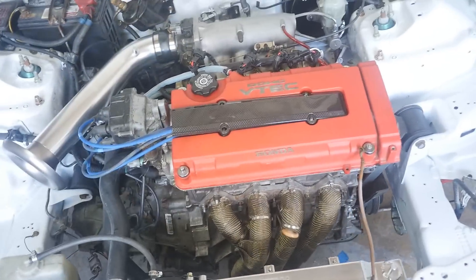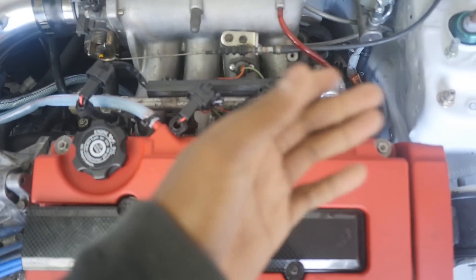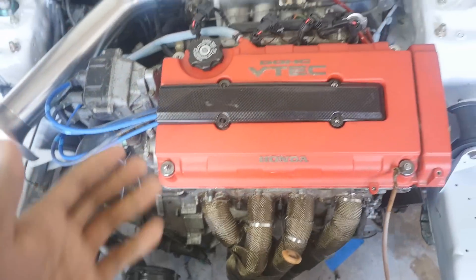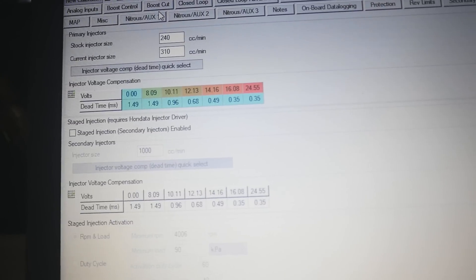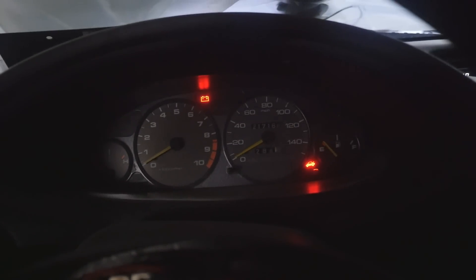The car didn't start, and that was like three or four days ago. After doing some research I realized I had to do some tuning work to the injectors — these are 310cc — and these are clips I got on eBay. Also it wasn't starting because my distributor sequence was wrong; it was 3-4-2-1 and it's supposed to be 3-4-1-2. I went into the tune data, changed the injector size to 310, and it started right up — just like that.